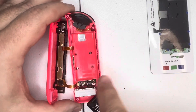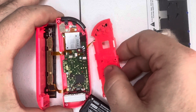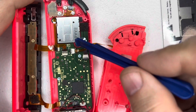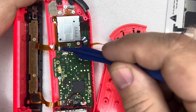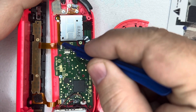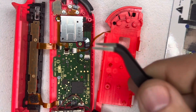Now remove this part which includes the shoulder button. Fold it to the right like a book again, because there is a little cable you don't want to stretch or pull on. The only cable you need to release from the plastic connector has a safety tab right here — it's black. Take the point of the plastic spudger and just gently get in there and pull up gently.